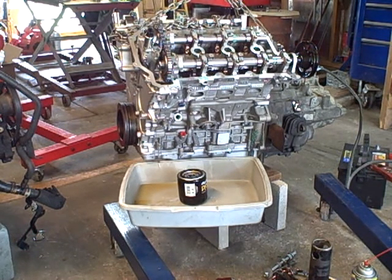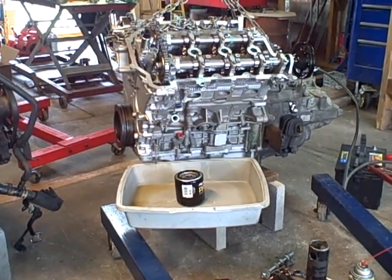There's noise in the valve train from the chains. I'm not sure — I wouldn't call it normal, but it's not necessarily alarming; it's something I'm concerned about a little bit. Nothing came out of the oil filter hole or the oil sender hole where I unscrewed it. That's the end of video three.